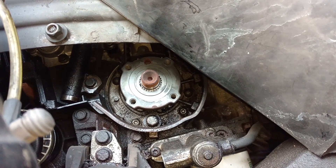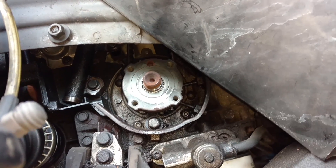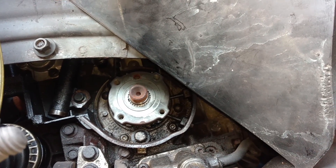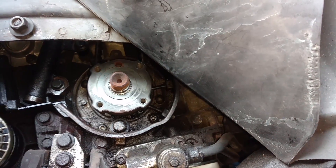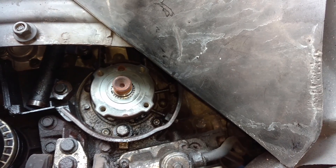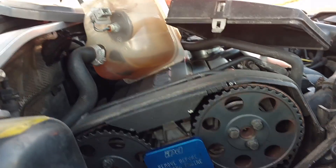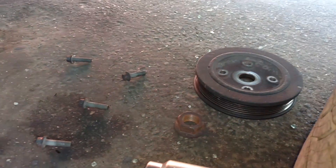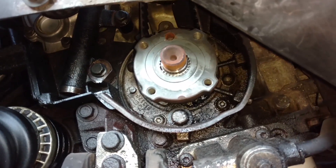I hope you found what you're looking for. To get the crank bolt loose, I broke it free with a high power impact. Then I aligned the timing, and broke those 10 millimeters loose. You should turn it and take the one out of the top corner out first if you want, or take two of them out and leave two in. After the timing is lined up, I stuck the cam locking tool in since I'm not pulling the belt. Then I come back down here and remove that harmonic balancer bolt. I'm going to replace the harmonic balancer since so much of that rubber is cracked. I got a better one from the salvage yard.